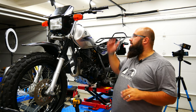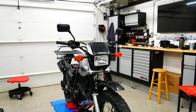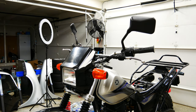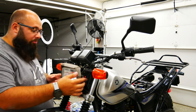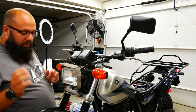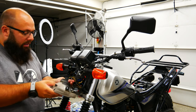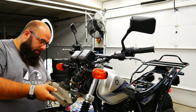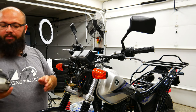Now that that's done, let's lower the bike, see what lights we have to work with, and figure out how to put them on. This fairing looks straightforward — there's a Phillips screw here and just some pressure clips, so let's get my screwdriver. Looks like we have two 10 millimeter bolts on the side here to remove the light and then we can replace the headlight. That was simple. It looks like there was a little rest down at the bottom for a bracket to sit on. Now let's actually remove the light from the wiring, which is simple. That is done.